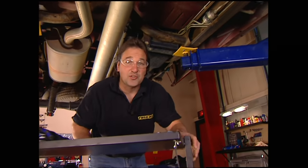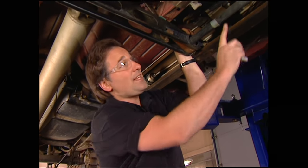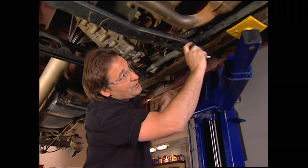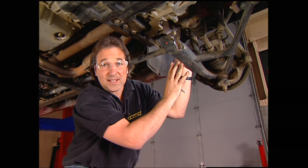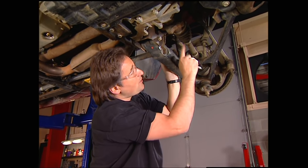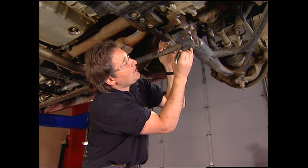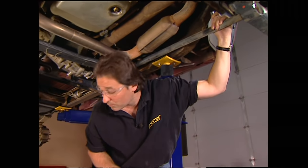The first thing you need to do is get the truck up in the air, get the wheels off, and then take out the torsion bars. For those of you that don't know, a torsion bar is under load back here, and that transfers up to the lower A-arm — this gives you your spring rate. On a four-wheel drive, this takes the place of a coil spring because your axle shaft runs right where your coil spring would normally go. Make sure that you mark them really well, so when you reinstall them, they go back exactly the way they were.